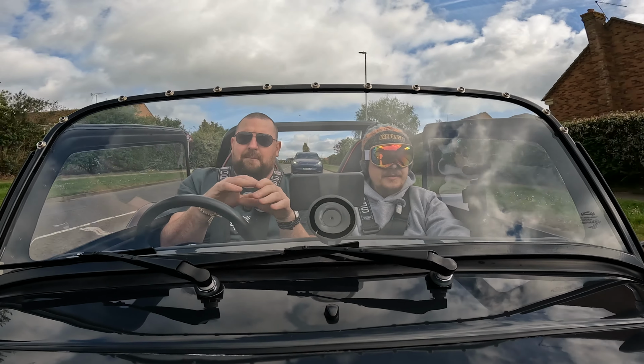So if I've got a brand new car, kind of a modern style engine, I can't run this. So what are the criteria for who's looking for a carbon airbox like this? It's generally designed towards carburetor and throttle body applications. Newer vehicles are all on a single throttle body or turbo application, so it doesn't really give you the ability to fit this to it. Because it runs off a base plate, you need to run that over carbs or throttle body, so it bolts up to the actual base plate of that itself. So yeah, newer applications don't work as well, but that's where we come in with our new Air Max range for all the carbon stuff. Pipercross heritage open cone intake stuff that we do with heat shields and everything else, designed specifically for applications.